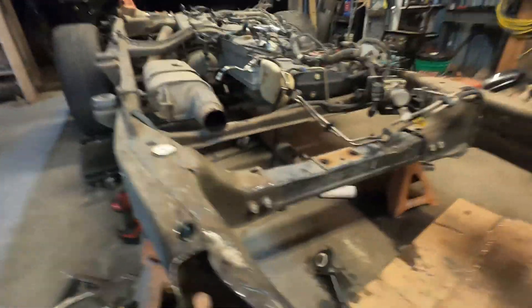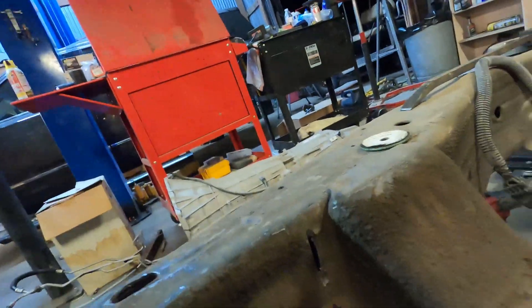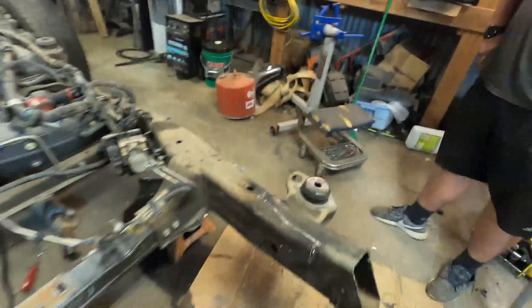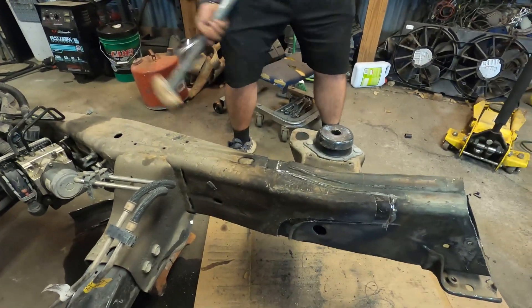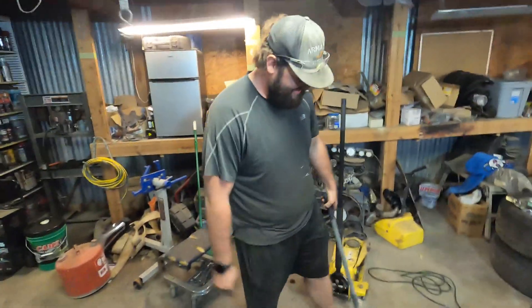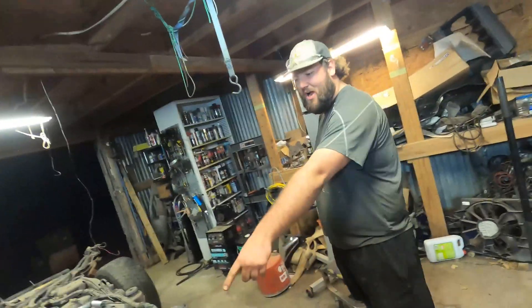A few moments later — this side we've whacked and whacked. I used the old chief, reached up inside, and cut it in four pieces and it still wouldn't come out. The quote-unquote bump stops we talked about earlier weren't bump stops — they were welds. We ground out the welds from the back side, Cory has gone around the pocket, and let's see if it works like it's supposed to when you cut the welds. It's moving! That's how it's supposed to go — four hours on that side, 30 minutes on this side.